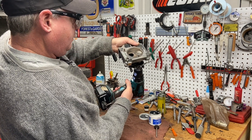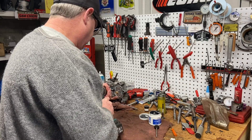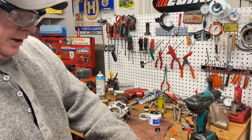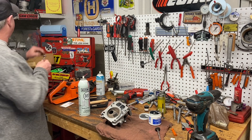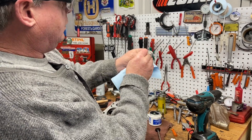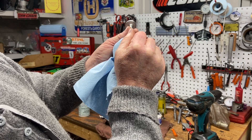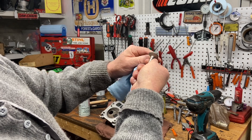Go the other way again a little bit. Okay, take that off, take our valve out, and brake clean the valve — brake cleaner or brake clean — just something that's going to get rid of the residue. Let's have a look at this now. Okay, nice line, pretty much even all the way around the valve. You can see that gray line right in the middle of the valve, so the seat and the valve are contacting right in the middle. That's where I always thought it should be — doing old Tecumseh and Briggs valves years ago.